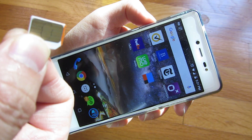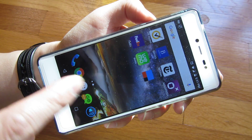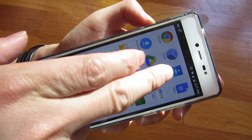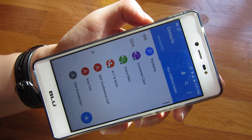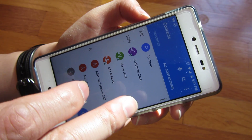So in order to move contacts off of your SIM card, what you have to do is — your SIM card is obviously in your phone — go into the Contacts app. Make sure you go into the Contacts app under Android, and not under the Phone app, because the Contacts app has different menu options.